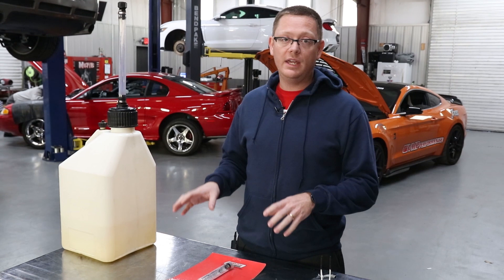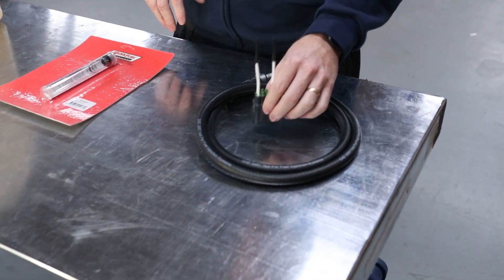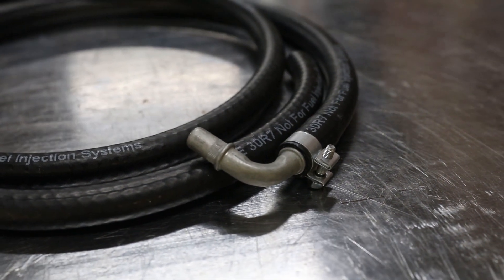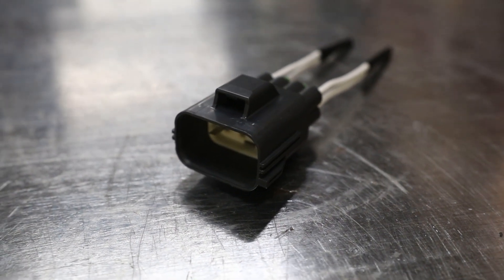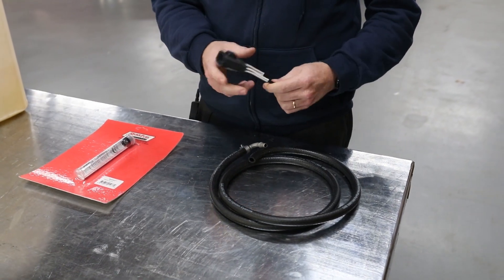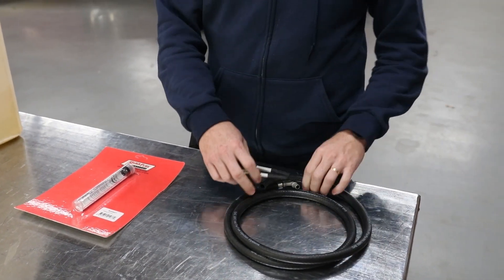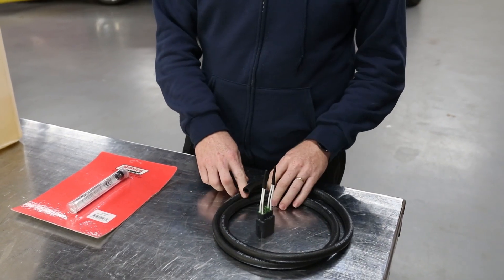In the E85 starter pack we're going to include the following items. Most importantly you're going to start with the fuel drain kit. This is a hose and a fuel line fitting. This will fit into the factory fuel connector up by the fuel rail, and we include this jumper harness that is going to jump the fuel pump driver module in all coyote powered vehicles — covering the Mustangs and the trucks. You're going to disconnect the fuel line at the fuel rail, plug this in, this goes into a separate tank, plug this into the driver module and turn the key on and it's going to pump it out.